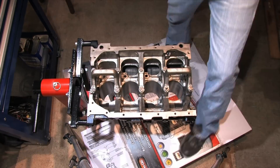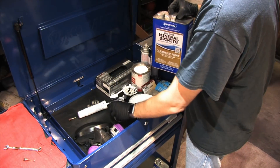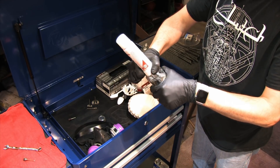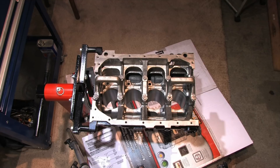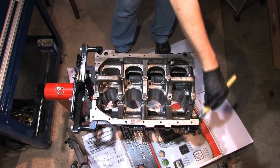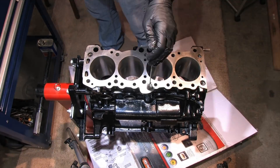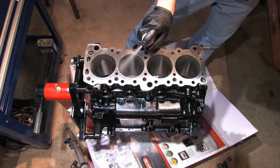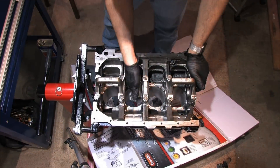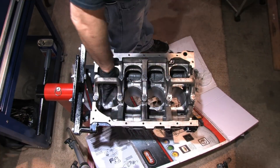Next it's time to wash out all the funk we just stirred up with a petroleum-based solvent. This is an aerosol spray bottle that you can fill with whatever will fit through the nozzle, with replaceable aerosol canisters to propel it. I'm using mineral spirits here because it penetrates, lifts out oil and dirt, and dries up completely in a short period of time. Basically: soak it all down first and mash the parts-cleaning brush deep into all the nooks and crannies to loosen anything that's hiding. Keep the block well saturated, then flip the block over, spray it out again, brush out all the oil galleries, and wash out all the cylinder bores. Use coffee filters to wipe down every surface to remove all residue — they need to come out clean and white before you're done with this step. You may find that you have to wipe the block clean and reapply several times before achieving that result.